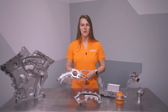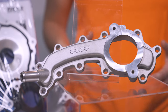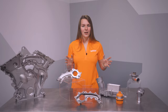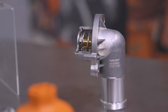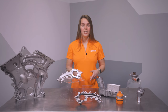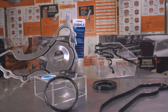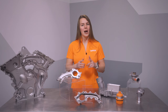This piece does serve as a crossover pipe, but it's also the lower half of the water neck too. And guess what? The factory made that piece out of polymer as well. We offer a few pieces that differ in application, but all have been improved in the same ways. The material is changed to rugged aluminum with casting fins that offer rigidity and even assist a bit with cooling, drawing heat away from the casting to help keep temperatures down and stave off cracks and warping. Sealing this off is a premium molly gasket too. Check out our fitment guide to find the right thermostat housing for your application.